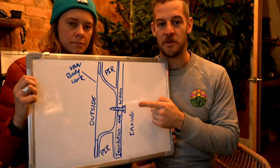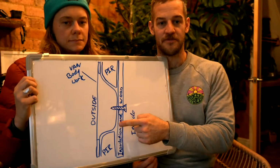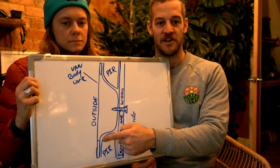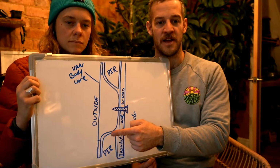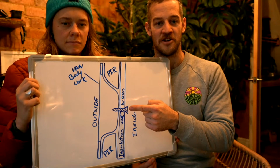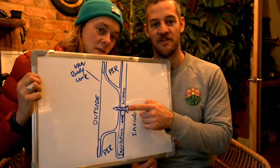A common mistake is people will fire a screw through all their lovely insulation job straight into the bodywork. Any cold which is touching this metal goes around it. Normally there's a little bit of rubber here to stop it, but sometimes it's spot welded on. The cold goes all the way through this metal, through your screw, through all your lovely insulation job, and then you get a moisty, condensating screw head. That's where it drips on your head.